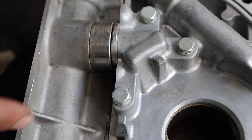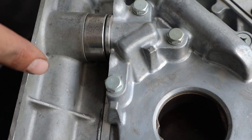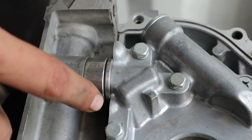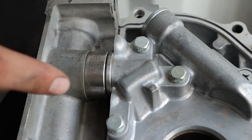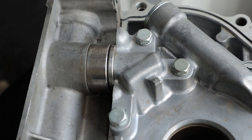To fix this issue we machine the part section that drops down into the sump. Then we put a fitting into the sump to make up for the area that's machined, and an o-ring goes between it to seal it. So it becomes like a D40 setup and then you can pull the oil pump off the front with the sump in place.